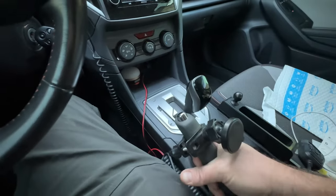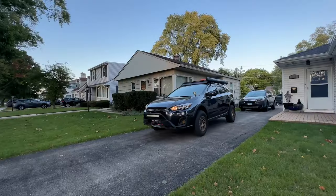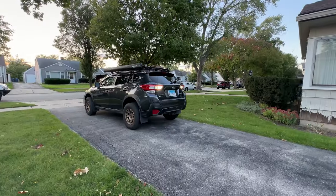Next I'm going to put it in drive and engage the e-brake — I should not go anywhere. That's to test and make sure the emergency brake is still working. Brake light comes on, I'm not going anywhere, I can give it a little gas and I'm still not going anywhere. Number two, check. Next I'm going to pull forward in my driveway a little bit before hitting the main streets, hit the brakes, test — I do stop. I'm going to put it in reverse, do the same thing — go backwards, I stop. I don't feel like I'm using front brakes only — I can feel the rear brakes engaging. You can especially feel that when you're going in reverse — the rear end should dive when you hit the rear brakes, and mine does just that. No squeaking so far, so I think we are ready to take it on the road.